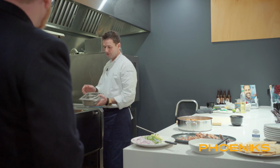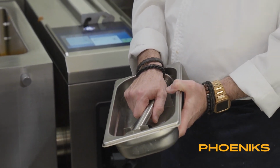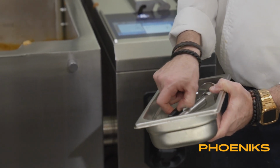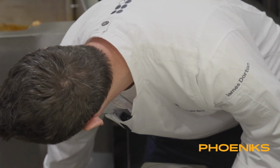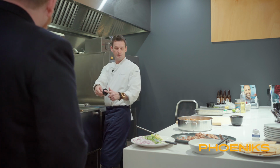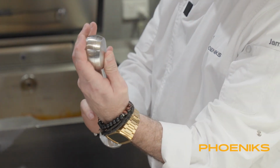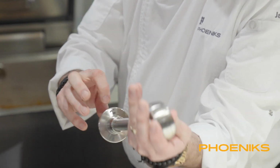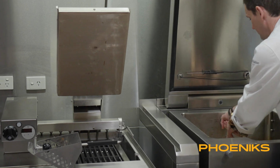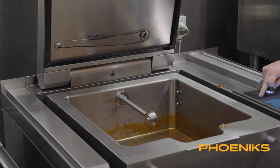Two sides. So this is the cleaning lance for the self-cleaning hot plate part of it. It sits in its own little housing underneath. Here are the slots where you put the lance arm, and a little spanner that basically goes onto this. This part on here has a sliding mechanism. Slide it on four sides. On the arm, you've got the open lock, closed lock. So you just place it under the closed lock. It's 4.8 kilowatts, three phase.